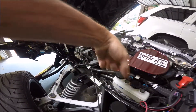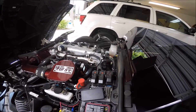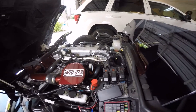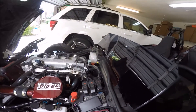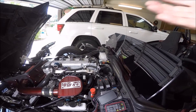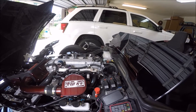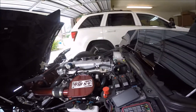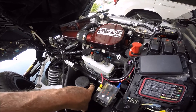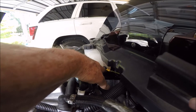So you don't have to run a long ground wire back to one central location. The frame and the engine are all grounded, so that is your good ground. Right here would be a ground — an easy connection — and over here is a place that I grabbed a ground because it goes into the metal.